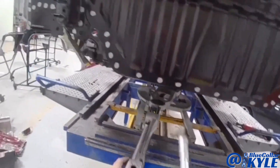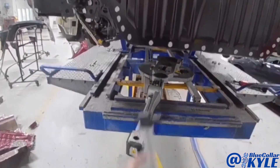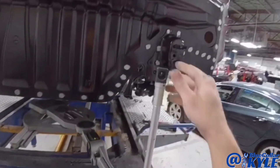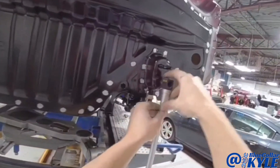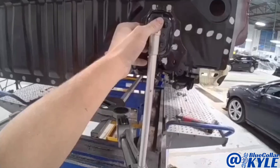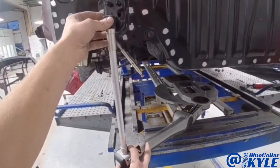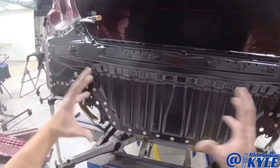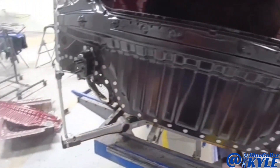I went ahead and matched the measuring system back to the car since I had moved the ladder — I had to recenter the car to the measuring system. I'm going to come back here to the back and measure these points to see if I need to shift this any at all. The computer is telling me that this panel is sitting just a few millimeters too far to the left, so I'm going to shift it over just a hair.